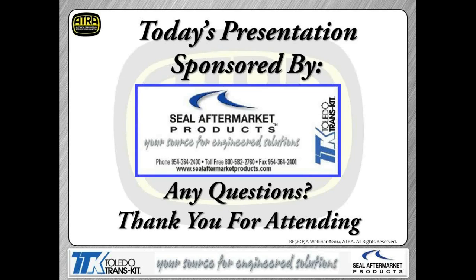Same thing with the rear planet. We have a 4 and 5 pinion. And on the center side gear, there's two different tooth counts. The one with 42 goes with the 5 pinion center planet, and the one with 43 goes to the 4 pinion. Now, looking at the rear ring gear, you can see there's two of them that are only one tooth difference, and then there's one of them that's 110 teeth. So you can see mix and matching these can cause all kinds of problems and all kinds of ratio codes.